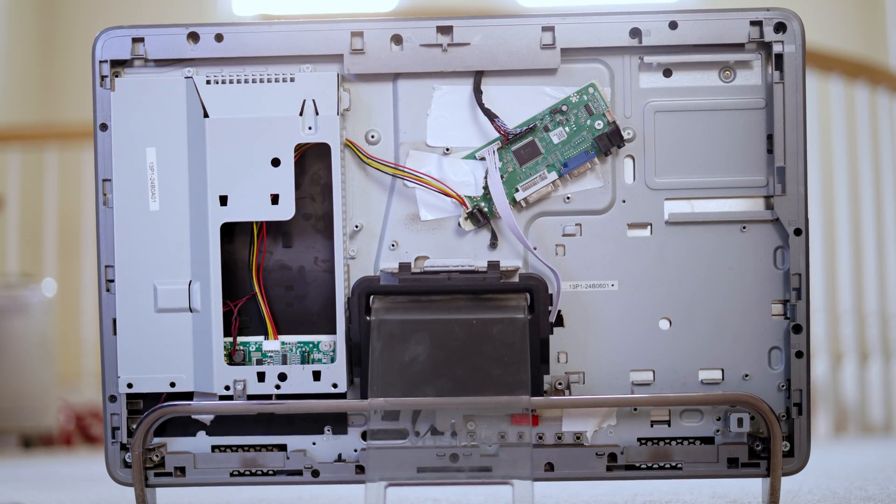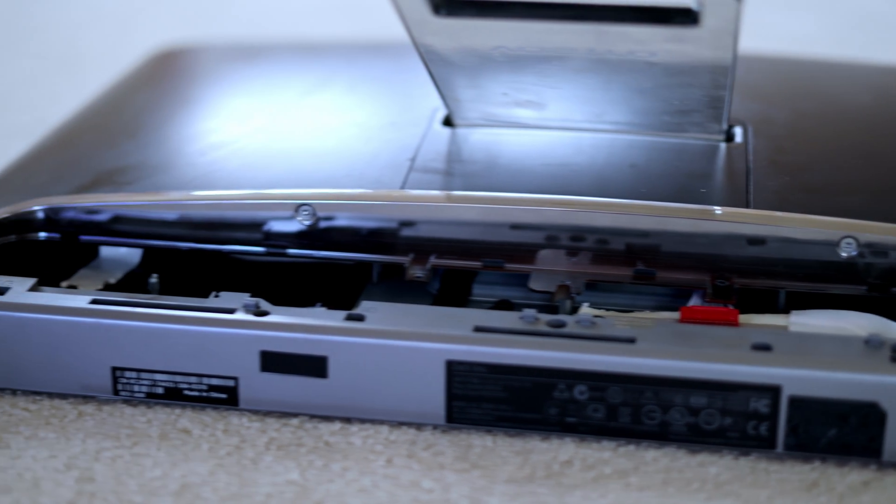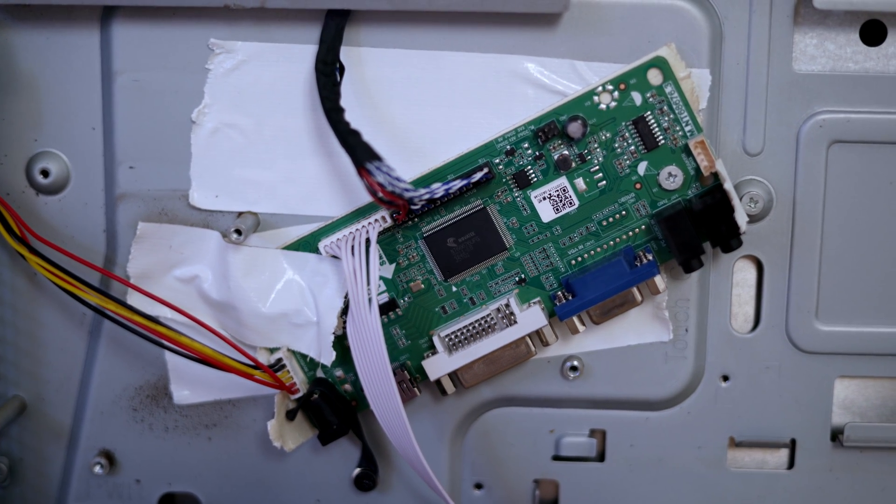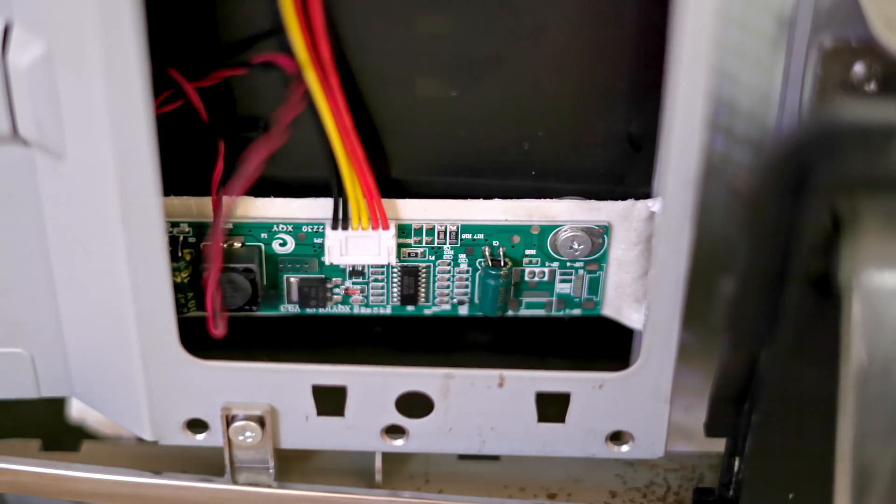I think I did a reasonably good job modding it. The biggest piece of plastic missing is near the bottom back, which isn't visible from the front. The optical drive is also missing, but I could probably fill it in with a plate taped in there. I put a lot of tape and screws to hold down the boards as best I could, but due to how short the LVDS cable is I couldn't route the board where I wanted — like at the side where the ports normally are. Power consumption wise, the monitor is using roughly 24 watts from the wall, which is a little too much for my 1.5-amp 12-volt adapter, so I should get a bigger one.